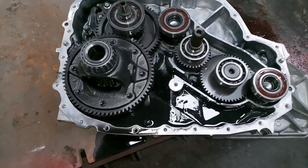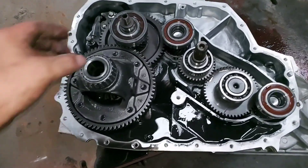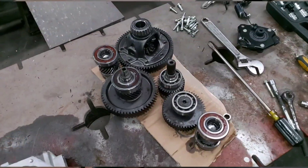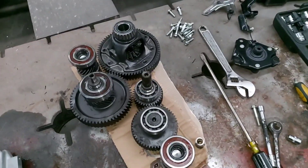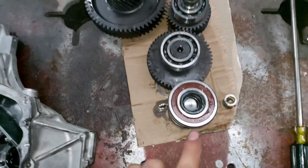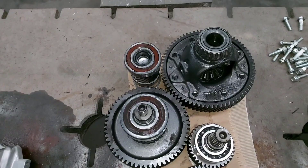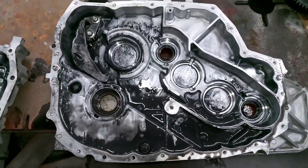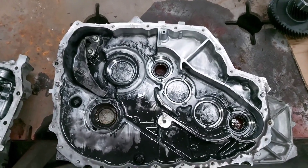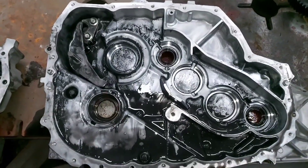We're going to take out all the gears and counter gears and finish inspecting the rest of the bearings. We took out all the gears: final drive, counter gear, reduction gear, main gear. We're inspecting each one. This one belongs to MG2, this one belongs to MG1 — and this really has me a little concerned. Remember, this vehicle has less than 30,000 kilometers with its original oil.